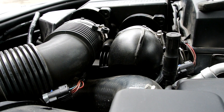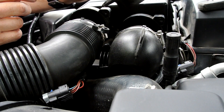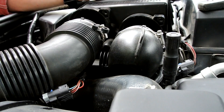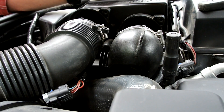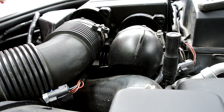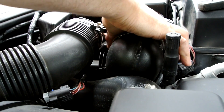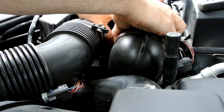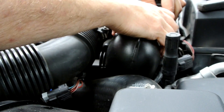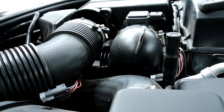The two sensors are nice and dry, so we're going to fit them back in reverse order. There's a little rubber seal on the inside, so I'm just going to give it a tiny bit of lubrication around it to help it in — otherwise it's a bit of a squeeze to get it back in. There we go. Without that little bit of oil it's a struggle to get it back in.